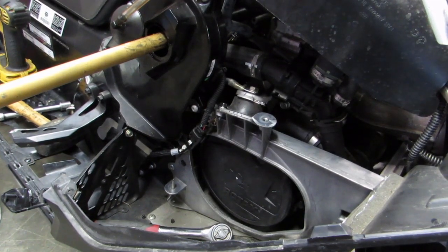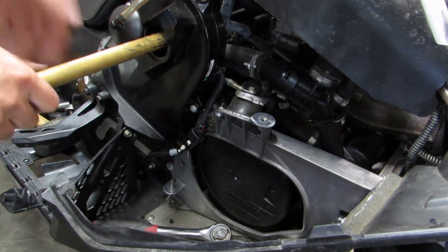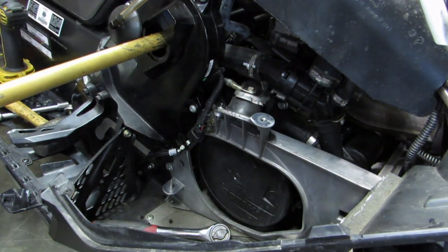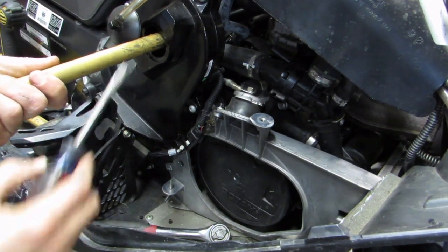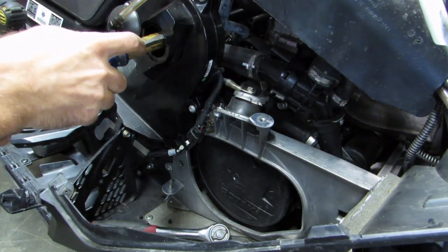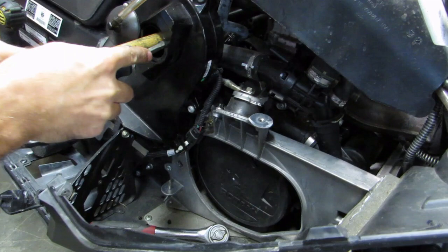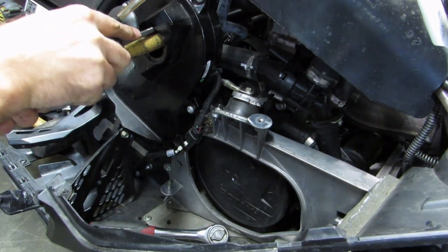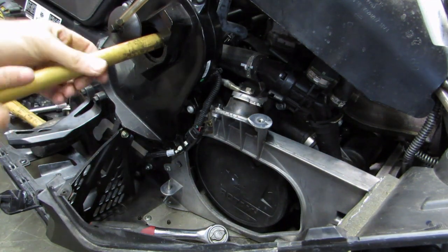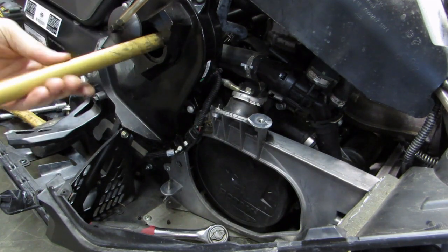The last step is you slide your shaft back through, screw your tool onto the end of the shaft, and then you can pull it through the bearing. It's going to stop against your top sprocket. The last little trick to using this tool is get a flat screwdriver and push some pressure on that top sprocket, then turn this tool until the sprocket engages the splines. Then you can take the tool out, put your bolt back in, put the bearing retainer on the other side, and you're all done.